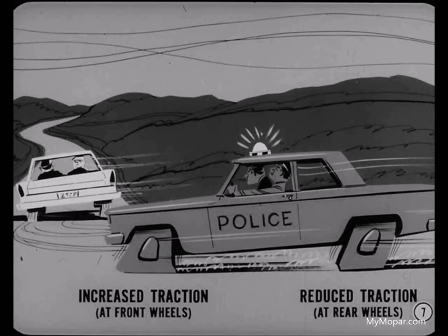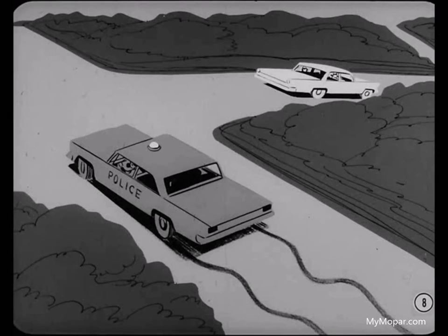Tech's right. For example, take the special cars designed for police work. They often have to make very fast stops from high speeds. Under these panic stop conditions, the forward weight shift produces increased braking traction at the front wheels and reduced traction at the rear wheels. As a result, the rear wheels have a tendency to skid on a panic stop made from very high speeds. You've probably heard that kind of skid referred to as fishtailing.